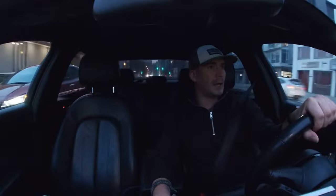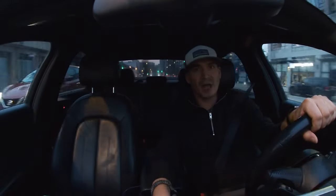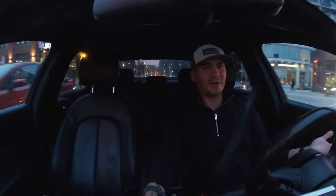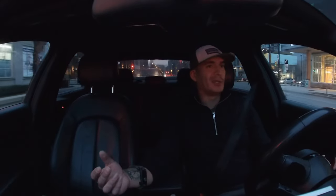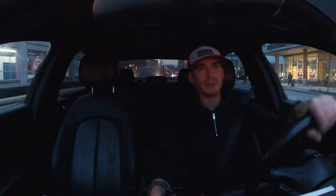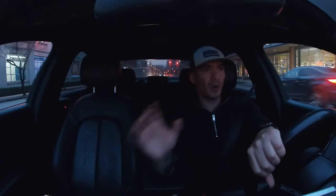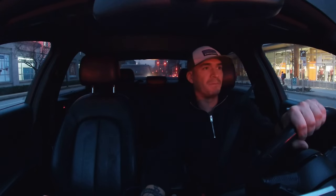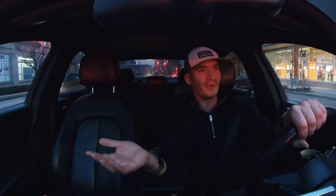With that being said, it's getting around 7 liters per 100 to 8.8 on the highway. Like, it's just idling around, 8-speed automatic. It's under 2000 RPMs when a guy's on the highway going like 100, 110. So that translates, for my American viewers, to over 30 miles per gallon. Once you go 7.7, 7.5-ish, you're well over 30 miles per gallon. I don't know the exact numbers, but I do know that it's over 30 miles per gallon around 7. I know that because of my Q7 TDI that I flipped as well, and all the other TDIs that I've owned that were deleted.